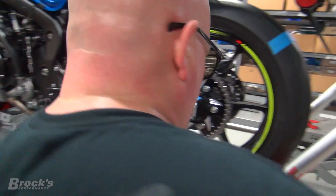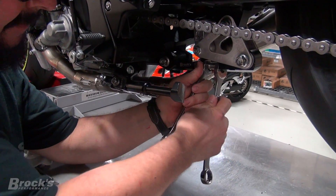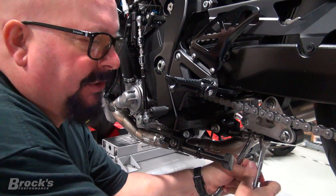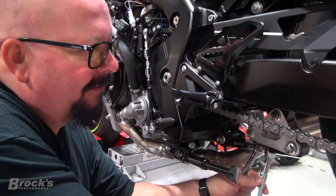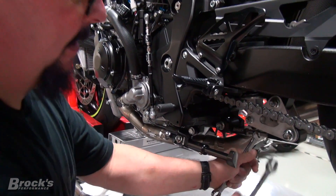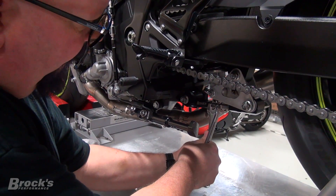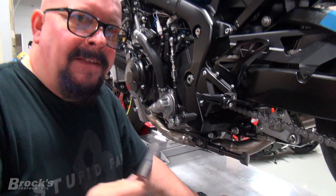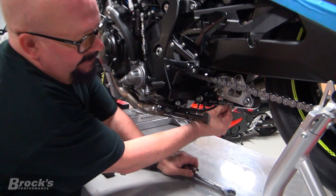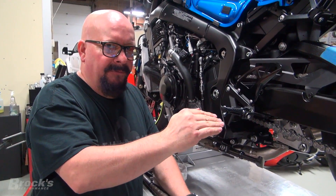This part is difficult for some people to understand. Even though there is a torque spec between this thread and these nuts, most people don't own the tools that would even allow them to do it, so we just do them by feel. We're just going to tighten these by feel - tight enough not to move. But since these are jam nuts, they don't have a lot of thread engagement, so if you just torque the hell out of them and put 100 or 200 foot pounds on them, you can strip them. Just snug them. For future reference, if we want to raise or lower the bike a little bit, we pay attention to the L's and count flats - just go ahead and adjust it.